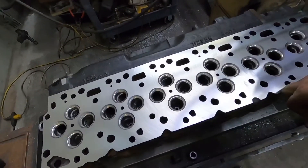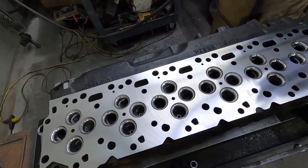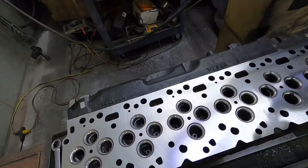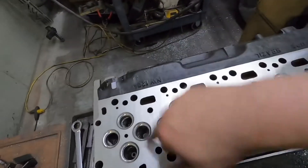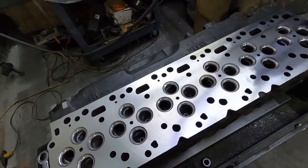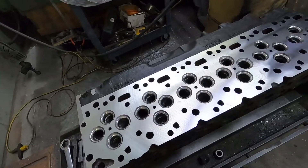I'm going to throw this up on the mill now and then we're going to o-ring it. I do have to do a little bit of thinking on what I'm going to use for a head gasket — I need to use a 6.7 head gasket but I might have to port the head gasket to use it. I also might drill the holes for the steam passages. There's a little contemplation before we go ahead, but that'll all be in this video.